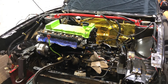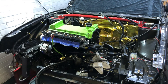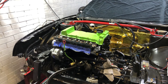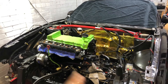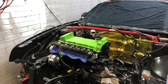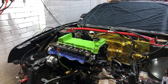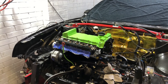What we're going to do as we're going back through and plugging things in is whip the injectors out and see if they're firing. Someone did mention to me that they can potentially stick open and just keep pushing fuel through, so we're going to check that. The second thing we're going to do is try the original HT leads instead of the Magnacore ones and make sure they're sparking as intended. Other than that, it's had all new sensors — the cam sensor, crank sensor, water sensors — they're all new, so I don't see why I'd need to change them again, but we'll see.